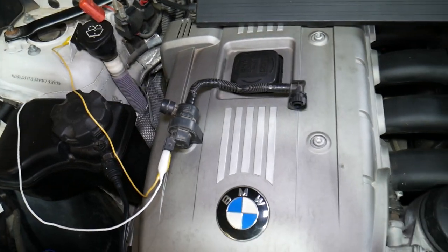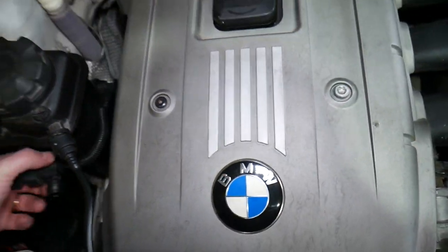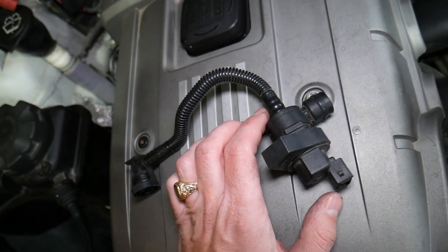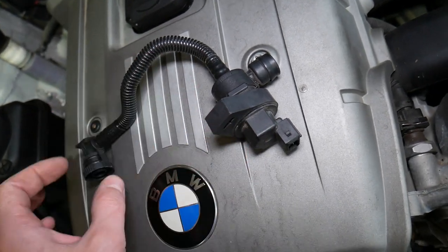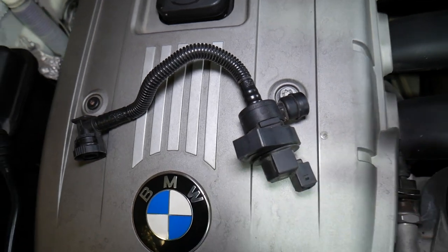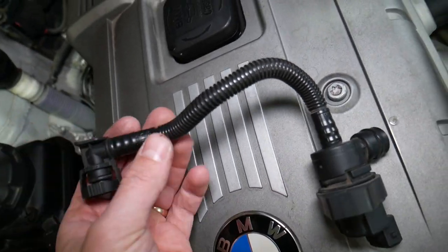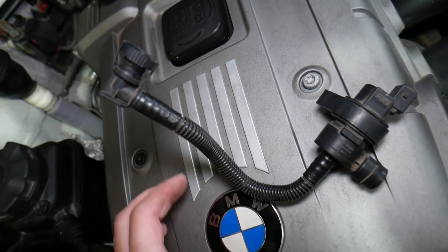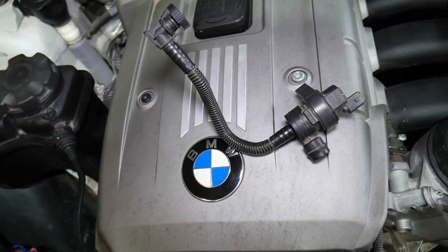Now, what else could go wrong? It can fail in two different ways: stuck open or stuck closed. Stuck closed means the valve does not open at all — you will easily get code P0443 or P0444, and when you apply power it will not open and air will not come out. Sometimes the valve sounds like it's opening but it's not. If it's stuck open, it will not close at all and stays open all the time. But sometimes what is hard to diagnose — it might be a good valve, clicking and showing airflow — but there could be a broken or cracked hose somewhere, or the O-ring may be leaking, and the car may develop a vacuum leak because of that. Always check that. Hopefully the video is helpful — thank you for watching, please subscribe for more help, and see you next time.